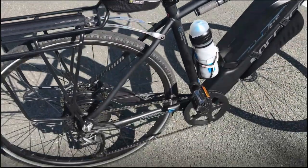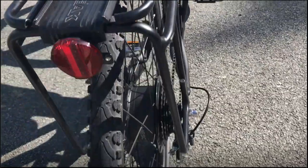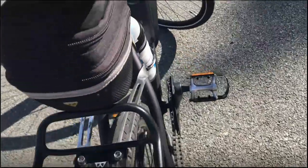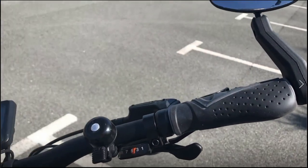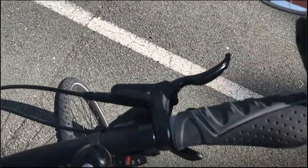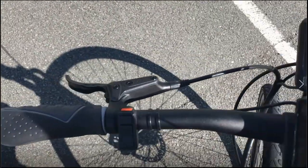The gears are very good - it's a nine-gear cassette with Shimano gears and derailleur. At the front there's only a single cog, so there's only one gear change to worry about. It's pushed to go up and just a flick at the back to change down - so easy, really nice, all one-hand operation. The brakes - I didn't realize until I'd had it for a couple of days - are hydraulic. No cables to worry about. Apparently they may need bleeding occasionally; you take the top off to access the reservoir and top it up with brake fluid.